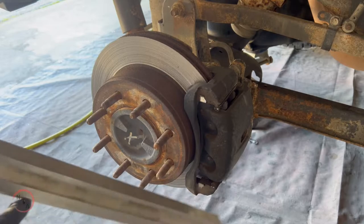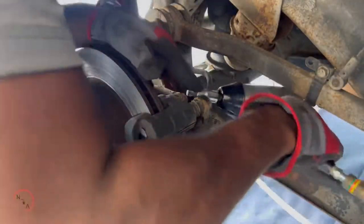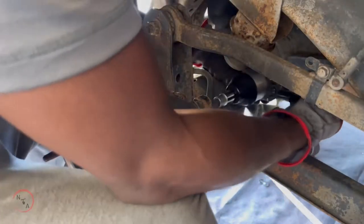Your pins may be stuck and stiff, so you'll need some type of breaking tool to break the screw loose. Once you do that you can proceed with the air torque gun or any other drill to remove the screws.